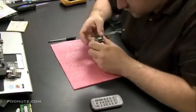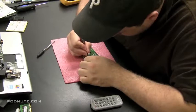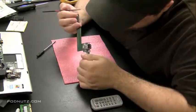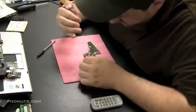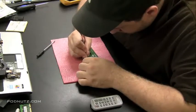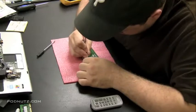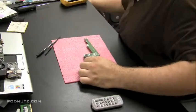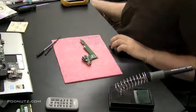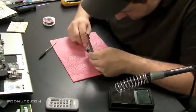What we're going to do now is take that circuit board and create two points where I'm going to solder a wire to make the connection. I'm taking a file — right above that little black cloud, somewhere where that positive connection is coming in — I'm going to file away a little spot and expose metal on the circuit board. I've got to file away some of that green coating, and then I'm going to drop some solder right on that spot to create a solder point. Then I'm going to take a wire and go from that point to the physical back of the power jack, basically bypassing the original configuration and using my wire as the new connection point.